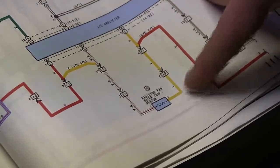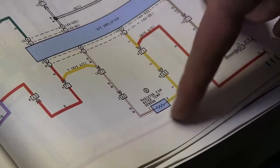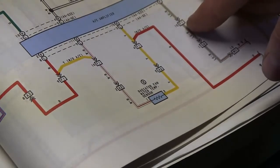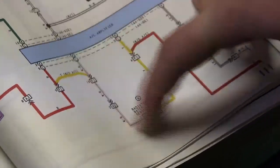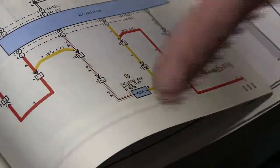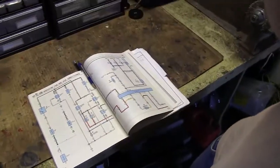The computer is seeing infinity resistance, so it thinks the radiator coolant must be really, really hot. We can manually control this. This is for cases where, say, I'm idling in traffic — what if this AC amplifier computer breaks? What if I start to overheat? What if I'm uncomfortable with my coolant temperatures? I can manually control this radiator fan to bring those temperatures back down by just adding a simple switch to the circuit. Now that we've identified which wires are controlling these temperature sensors, we can go ahead and install those manual switches.